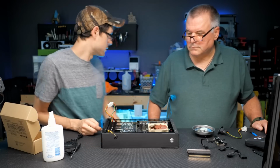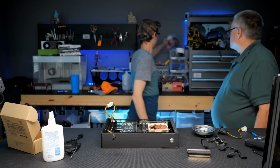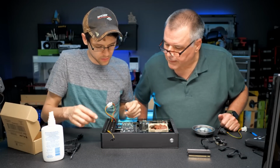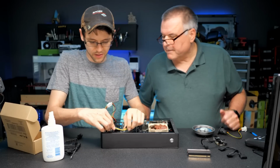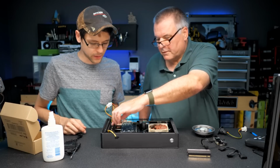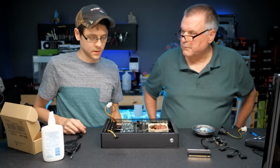After it boots, I'm going to use the gray mounting tape. One strip right there, one strip right there. And how does that mount in? With that mounting tape. Because you see, those screw holes are for the drive mount, for the drive bracket, but there isn't any on the other side. There's no screw holes for that.